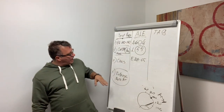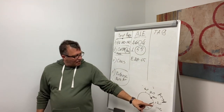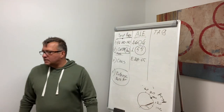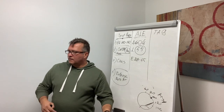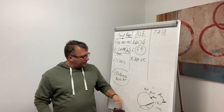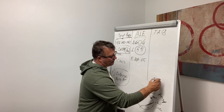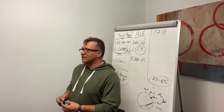You shut the engine when it was 120, right? When you push the brakes, by the time the minute passed, you release the parking brake, you push the pedal brake, your pressure will be, I would say, 75 to 85 PSI. That's what is going to happen.